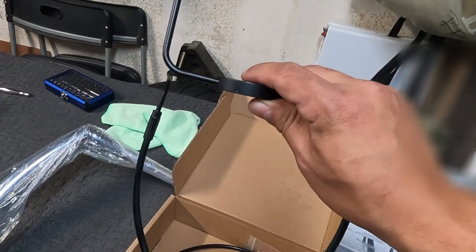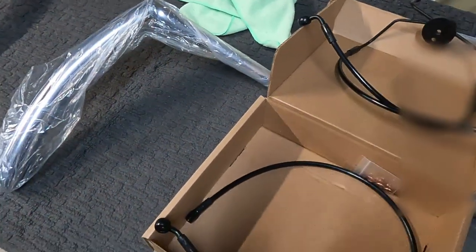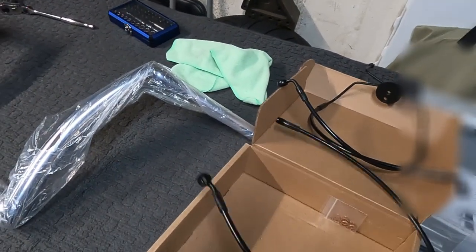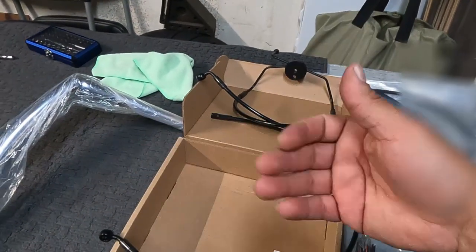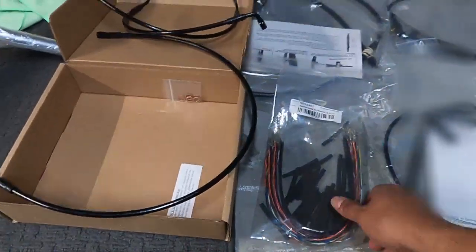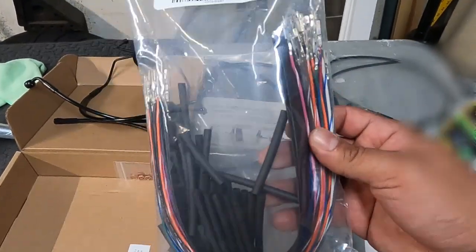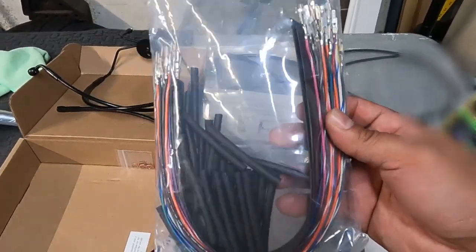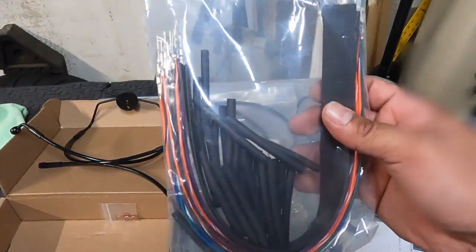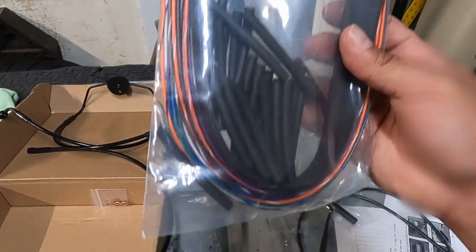Just because we're not changing that distance. I think all we'll need is the extended brake line to go from the grip to right underneath the chin of the triple tree. One thing that is going to be very vital is to extend the electrical wires. We'll have to do some pin work — just a couple extra steps. We'll get into the cabling more as we get closer.